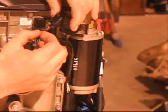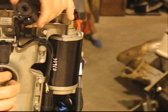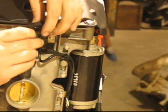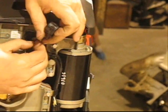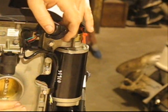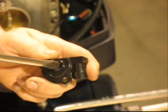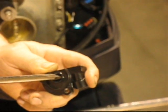It's a 3-wire sensor. It receives a voltage signal from the EMM on the first wire. As the throttle is advanced or brought back, there's a throttle lever that sits inside the sensor. When that's rotated, the EMM receives a return signal through the second wire. The third wire is a ground wire that provides a ground back to the EMM. The throttle lever is found inside of the TPS sender — we're going to pretend the screwdriver is our throttle shaft, and you can see that's what operates the voltage signal in the TPS.